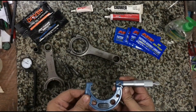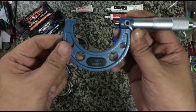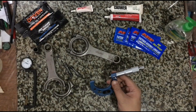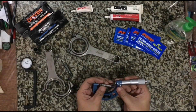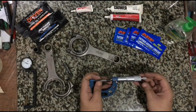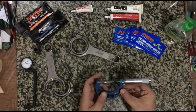On to the Eagle B20 connecting rod. Let's start with this micrometer — it's accurate to 0.0001 of an inch. We really do suggest taking the initial free length measurements of the rod bolts in the beginning before even torquing them. This way it becomes a reference point once it has been run hard and gets to its next rebuild.